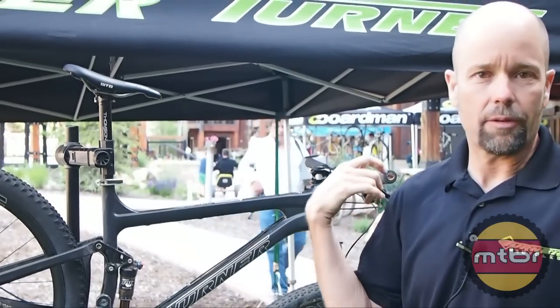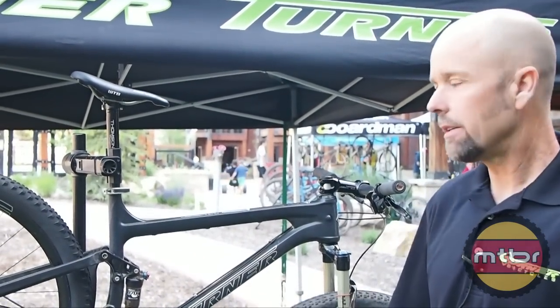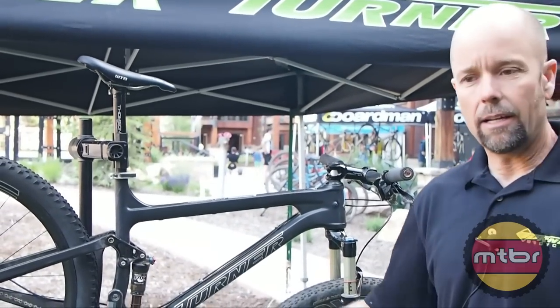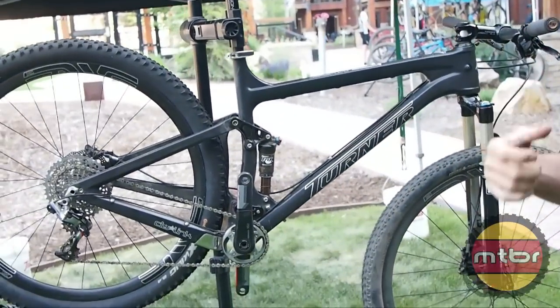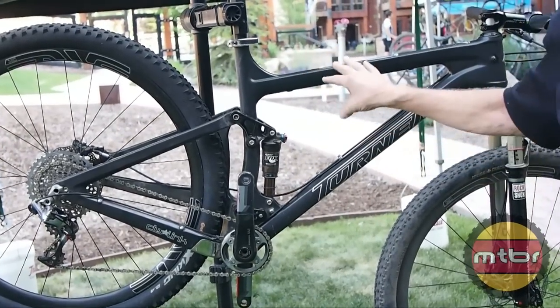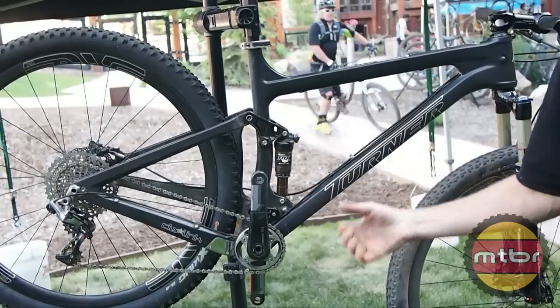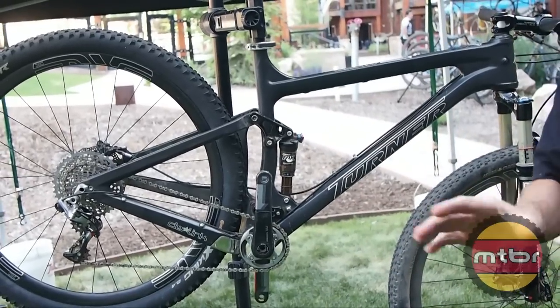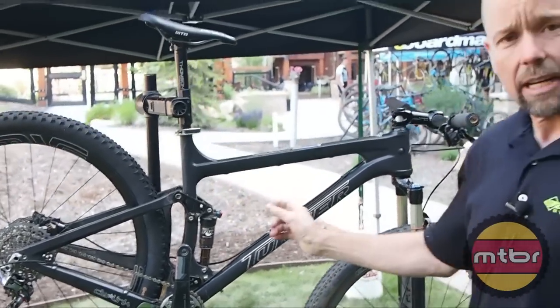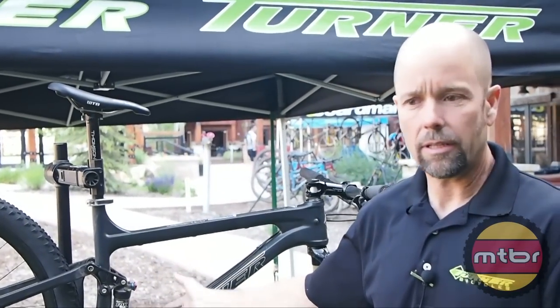This bike was designed from the ground up as a marathon bike. It's 100 millimeters of travel in the rear. We made it with a direct mount front derailleur, that way we got the most rigid shifting possible. It also freed up the design constraints for the shape of the seat tube, so we could make it as strong as possible, nice and flowy. The linkages are as short as we could get them, and being 100 millimeter travel, it comes with a shorter shock, which keeps the weight down.